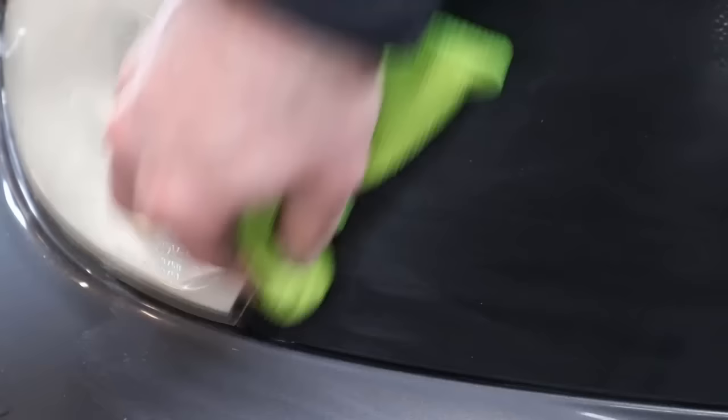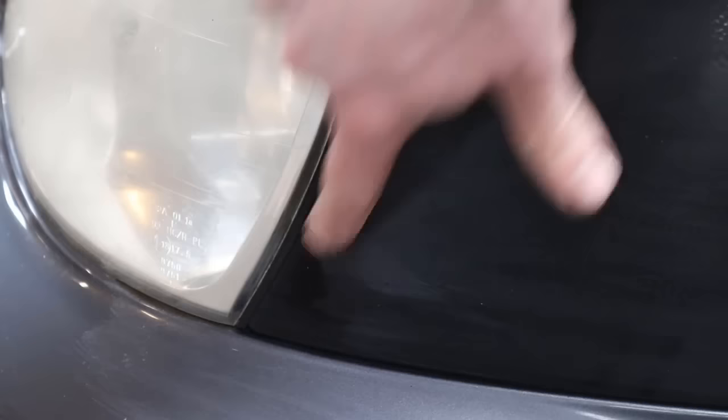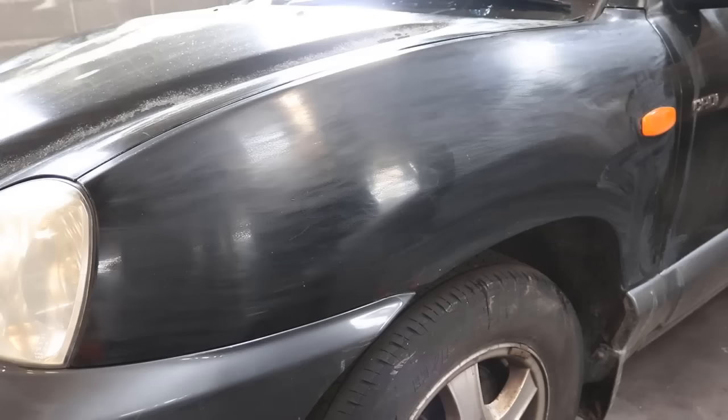It's important to check little areas like this where water could be hiding. Make sure there's no water trapped anywhere along here or along any rubbers — that way it can't come back out onto the surface when you're painting. Next we're going to get some masking tape and mask up the entire area ready for paint.